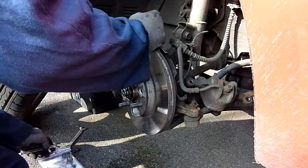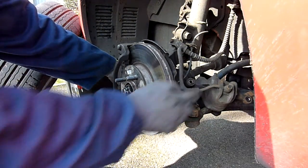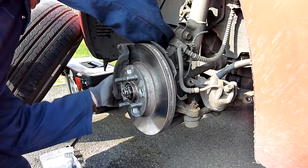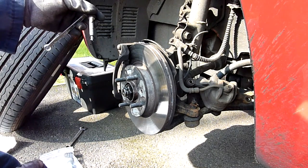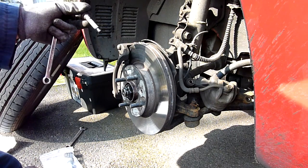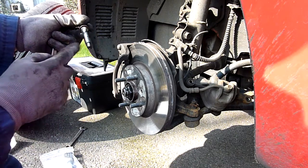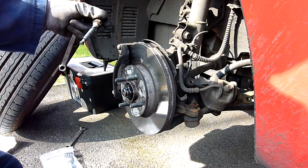Let's take the bottom one out — I suspect the bottom one's going to give me trouble. Once the top caliper pin is screwed back in I'll deal with this one. Okay, yeah — so at some point this was causing me a lot of problems and I pulled it off. And there it is — the rubber gator is not there. Could that be causing my brake pulsing? I don't know. Maybe the pins are bent from the impact. I'm going to find out by putting new pins and a new rubber gator in.